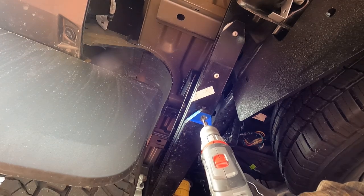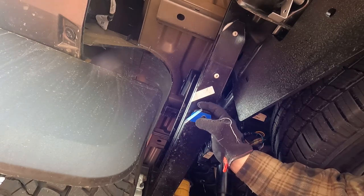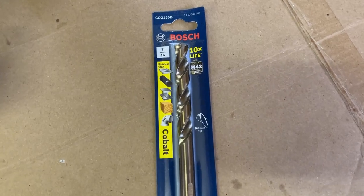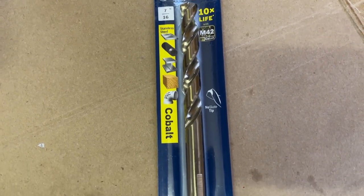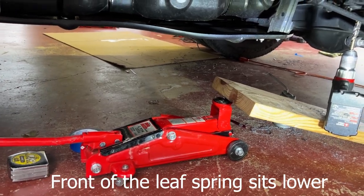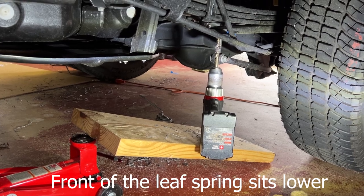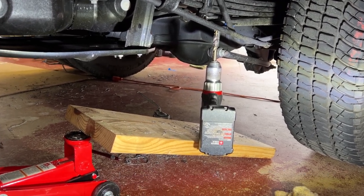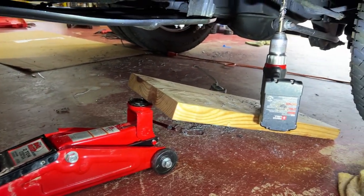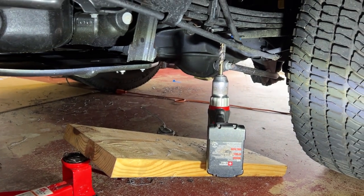There it goes — it's all done. Not too bad. Here's the drill bit I'm using: it's a Bosch Cobalt drill bit for hardened steel and it's working great. Got it on Amazon — I'll put a link below. This is what I found to work pretty well — hold the drill up, put some pressure on it, and drill the hole. The drill with the bit is a little too long to put on top of my floor jack, so I put that board down there, put a little leverage on it, slightly pump it up at the same time, and it works well.